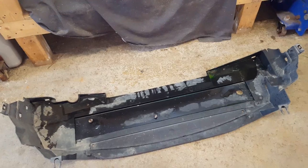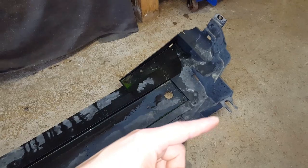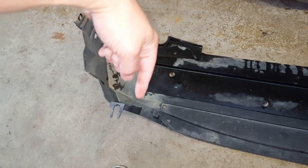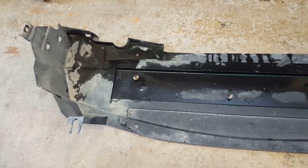We basically just started off by popping the hood, getting underneath and taking off the plastic underneath. Here's the belly pan — it's held in with two bolts, one there and one there, and these little plastic clips protruding out of it just slip into a hole in the bumper. Then you bolt them in on each side — real easy, 10mm bolts.